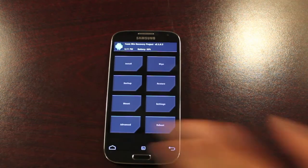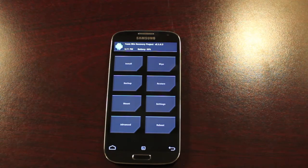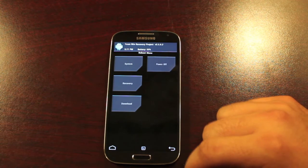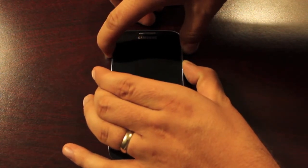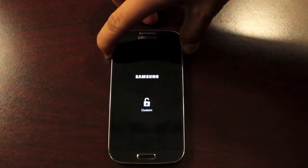So I'm going to power the phone down real quick and show you guys how to boot into recovery from fully powered down. So we'll go to reboot and power off. From the full power down, we're going to go volume up and power until we feel it rumble, and then we'll just continue to hold volume up. And that will boot us into recovery.